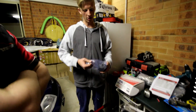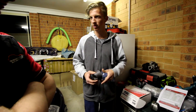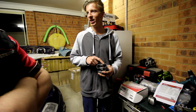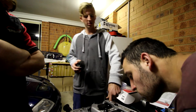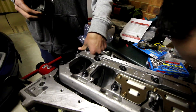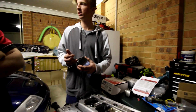Because of the unique shape of the skirt on there — it goes inwards towards the center — it's kind of good to reinforce the center of the piston. Apparently the oil squirter actually bottoms out on the edge of it, so fingers crossed we have clearance. These oil squirters have dowels which hold them in one position so you can't change the angle. The only things we can do is cut the dowel off and change the angle, or I spoke to Kelvin and he said we can just make a notch in the piston.